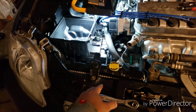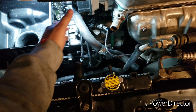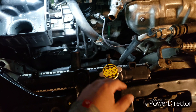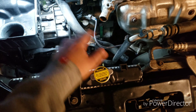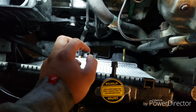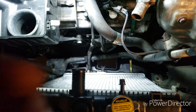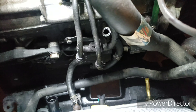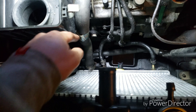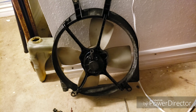Before you install, I know people are going to have issues with this - you see this opening with this little bushing? This has to insert through there because if you don't, it won't go all the way. You'll feel that it doesn't sit right - as you're putting your radiator in it's going to hit the top of the frame and you'll wonder why it doesn't fit. You've got to get it through there. After you've sat it down, add the bracket on top so it won't wiggle anymore - that makes installing the rest much easier.